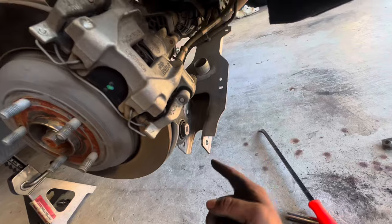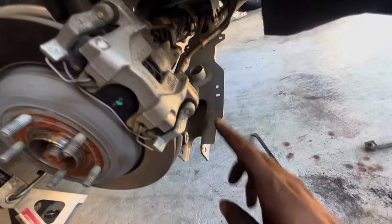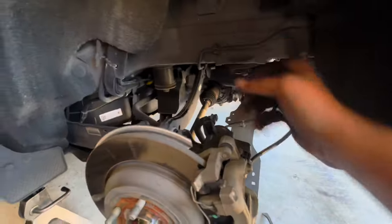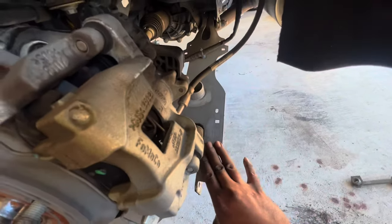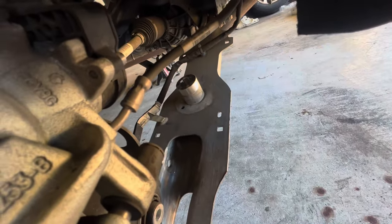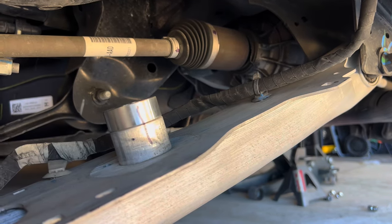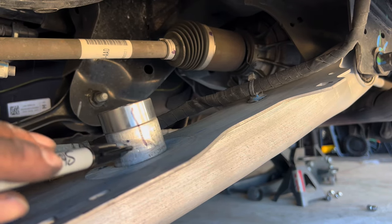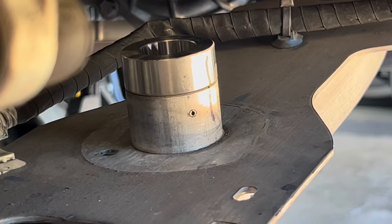The rear suspension is torn apart. I put some pressure up underneath with the jack, removed that bolt, then removed the lower shock bolt and the two upper shock bolts, and then slowly lowered the jack so the arm could come down. You remove the shock right there, and with a pry bar you get a little leverage and the arm comes down — actually very easy to push down. Then you remove the spring. The next step is to remove that lower spring isolator and take the RTR billet spacer and drop it right down in there.